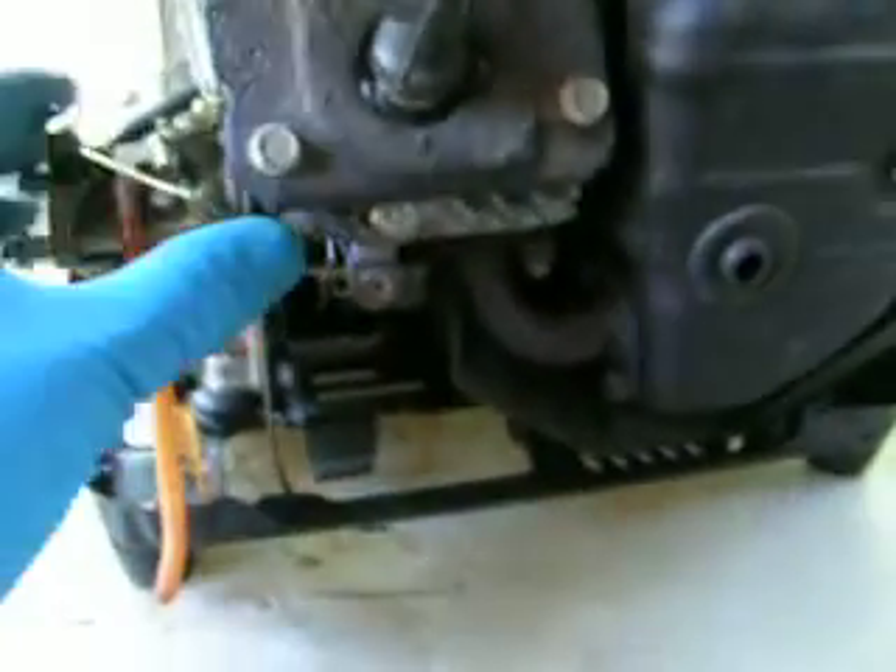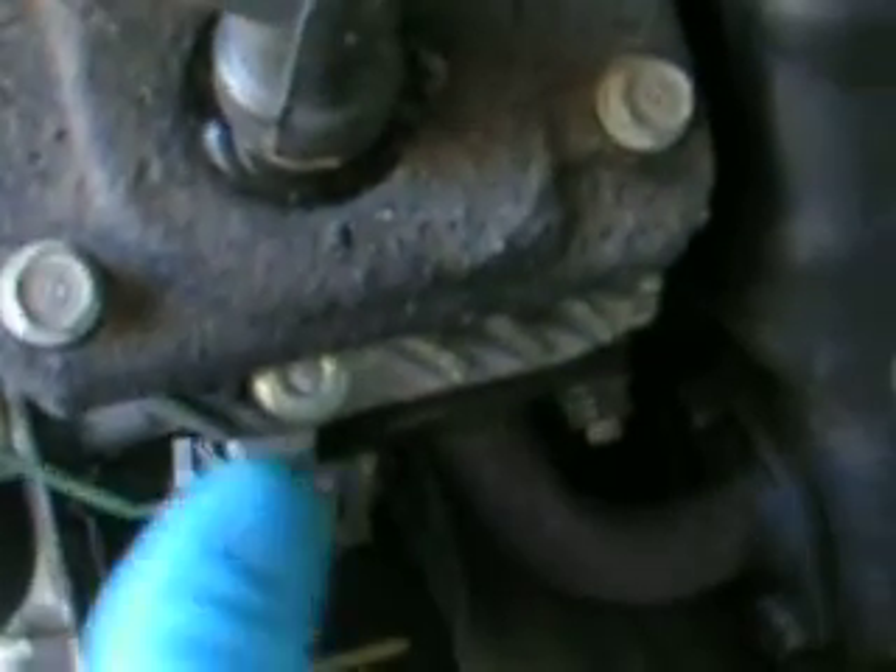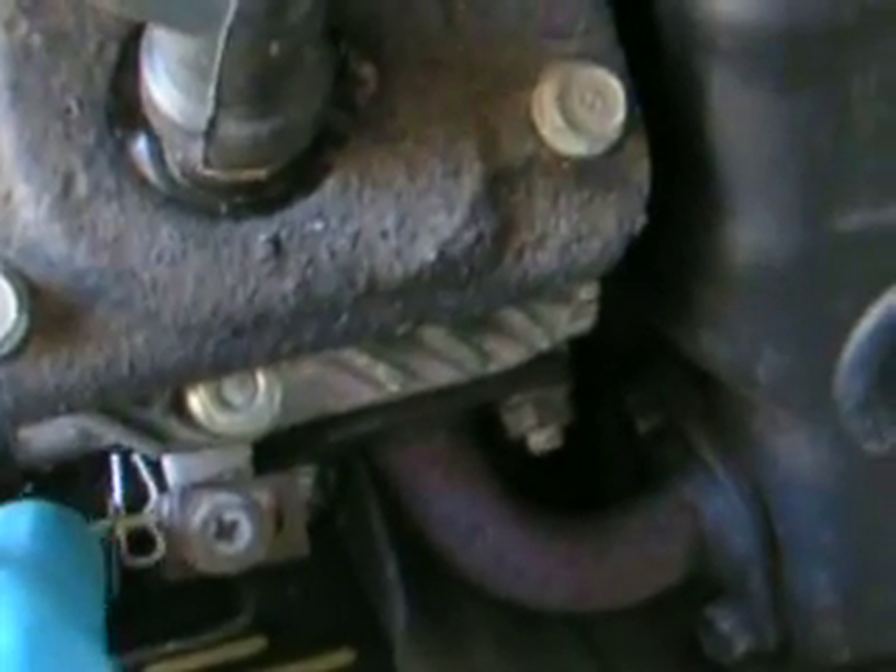I wore a pair of gloves because I'm getting tired of smelling like gasoline. I've got my choke set. My gap is correct, I think, between here, which is 3 millimeters. It actually looks a little bit more than 3 millimeters, but I'm good. As long as it starts up, we can adjust that later on. So let's see what happens here.